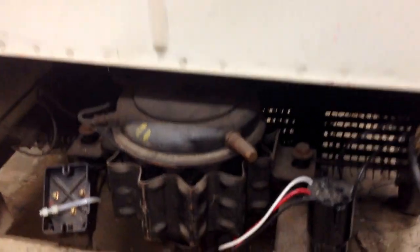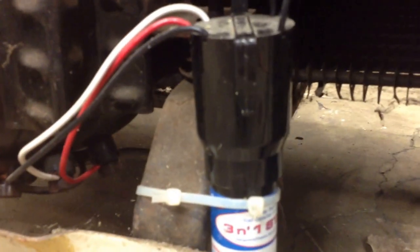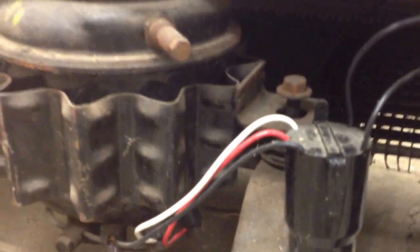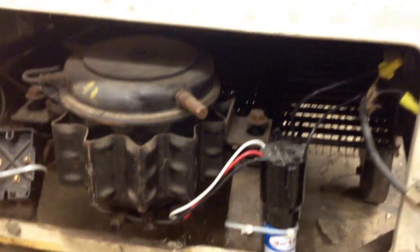It was being used with a Johnson Controls electronic add-on thermostat, so you would have to add one to have the compressor kick on and off. It's also had a 3-in-1 start capacitor added to it instead of the original wiring to help the compressor kick over when it gets hot.